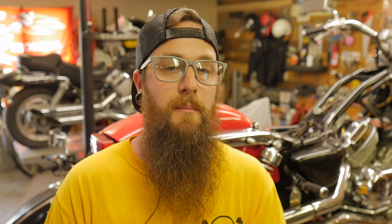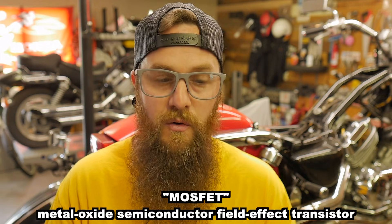Let's say you have an old bike — classified as one from the 60s, 70s, or 80s, a time when charging systems were changing throughout the decade. There are upgrades you can do to the charging system, one being a MOSFET regulator rectifier, which is capable of maintaining a very strict charge compatible with a lithium-ion battery that you can adapt to your old bike. I'll put links in the description for where to find these parts, as well as a list of recommended batteries if you want to do this upgrade.